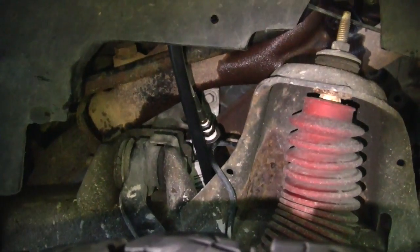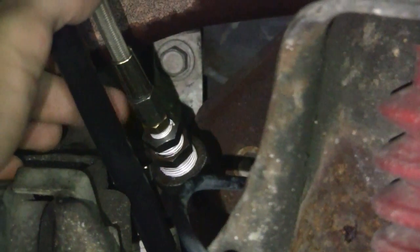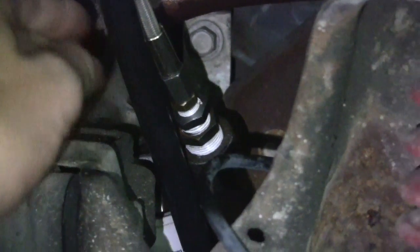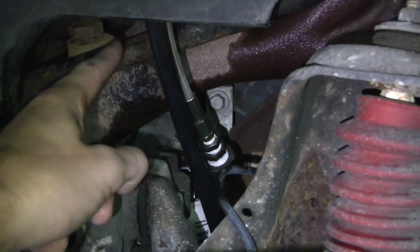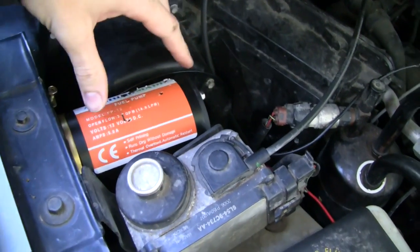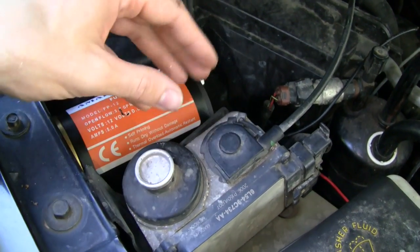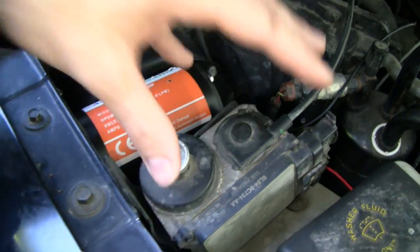Here's our connection right at the oil filter. You've already seen the sandwich adapter, and we've got our stainless steel braided oil line coming down with the flare fitting on it — just screwed it right on there. Real nice and clean setup, no messing around with hose barbs or compression fittings. Our feed line runs up right next to it, and both of them are on the same side of the transmission dipstick, so there's pretty much no chance of them ever working their way over to the exhaust. Up top I chose pretty much the same spot for the pump as I did on my other truck. The good thing about this pump was I didn't have to delete the cruise control — it was quite a bit smaller, so I was able to spare that.